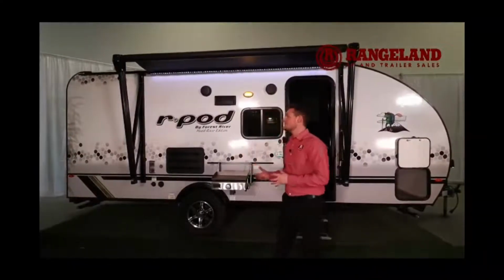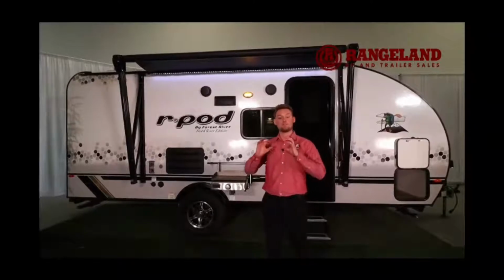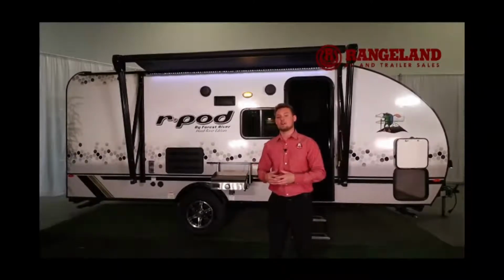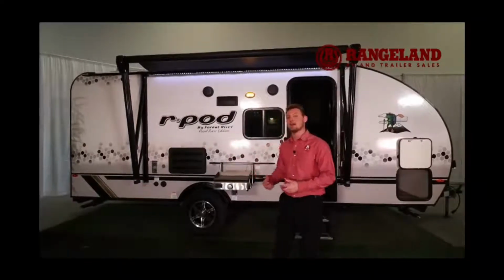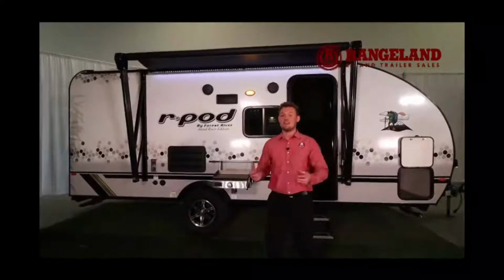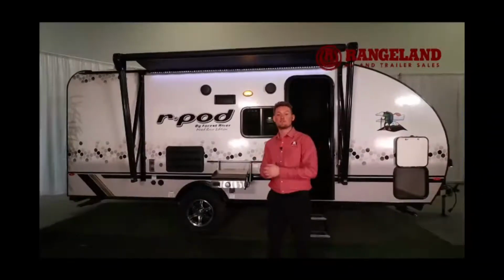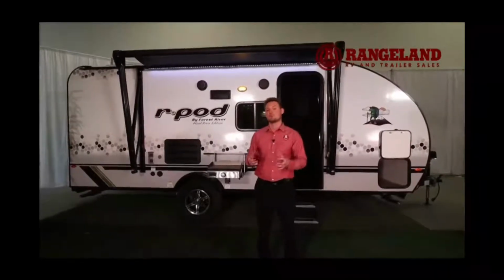So what we have here is a complete aluminum framing and block foam insulation, which is called a pinch rolled product. So this is awesome because it's a solid wall throughout on both sides and even into the back. They also do that aluminum framing into the roof and into the floor, and they even add that pinch rolling into the flooring there with the insulation, so it's a lot lighter, but it also keeps the floors warm.